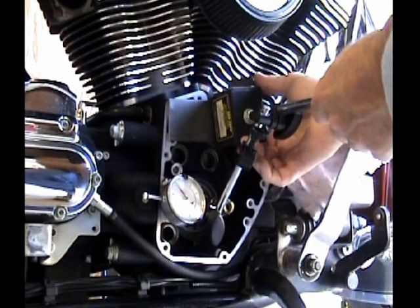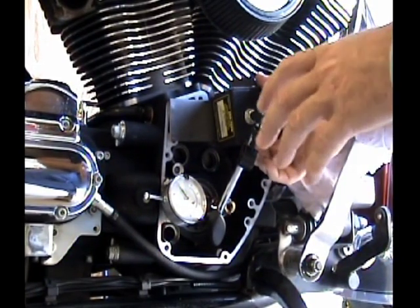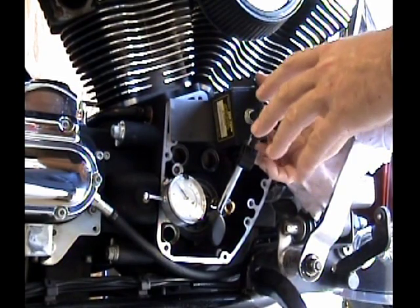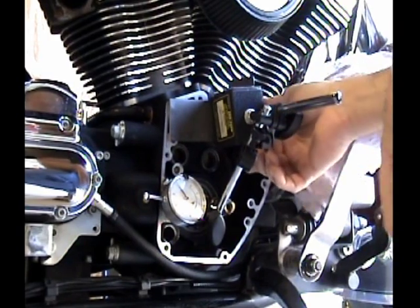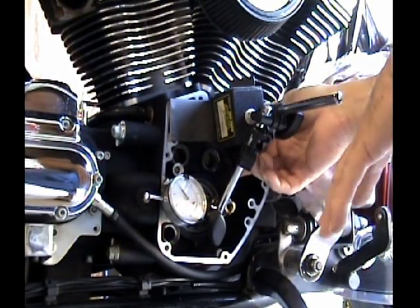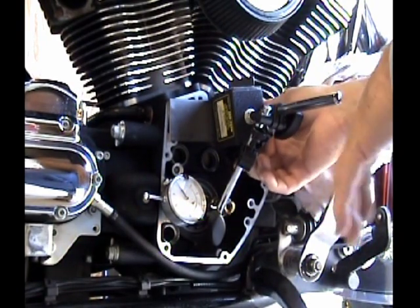Gear drive cams are more precise, but if the alignment of everything, all the shafts, the camshafts, the crankshafts, isn't almost perfect, then you'll get some gear noise. So essentially, you need to check a couple of things. One is the crankshaft runout. It has to be checked two ways. One is with the cam plate removed.